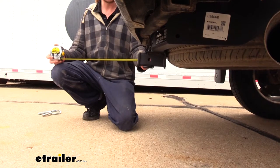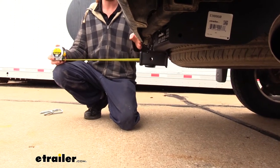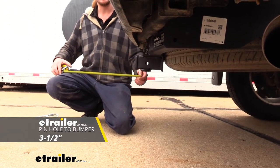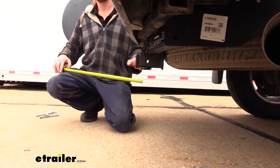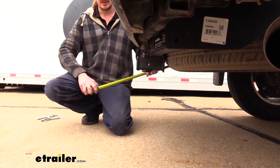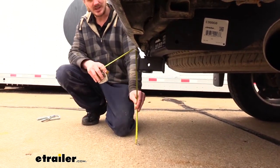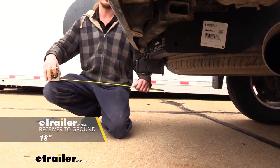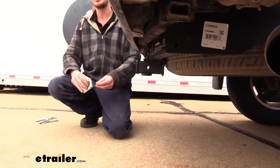I've got some measurements to help you when deciding on accessories. From the center of the hitch pin hole to the edge of the rear bumper it measures about three and a half inches — important when determining if folding accessories can be placed in the upright storage position without contacting the bumper. From the ground to the top inside edge of the receiver tube it measures about 18 inches, which is important when determining if you need a drop, a rise, or a raise shank on any of your accessories.